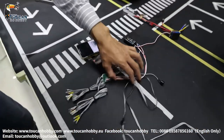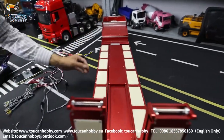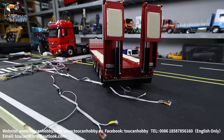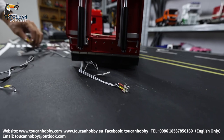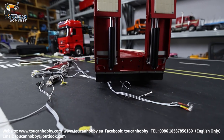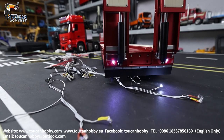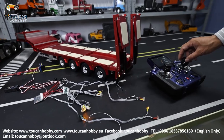So now all these wires are checked. Let's run it to see the effect. The throttle is already connected — we have the side light and rear light. Turning right — the right light comes on, and also the front turning light. Now turning left — this one here. Go forward and brake — this is the brake light. Go backward — the reverse light comes on.